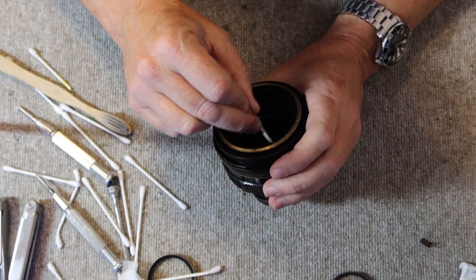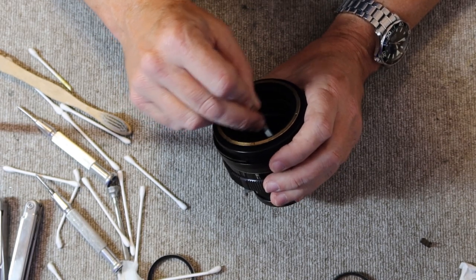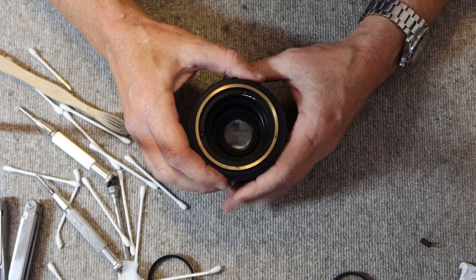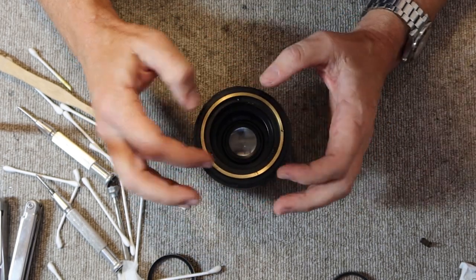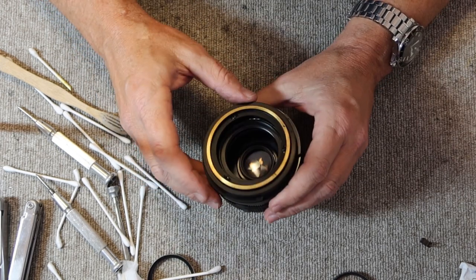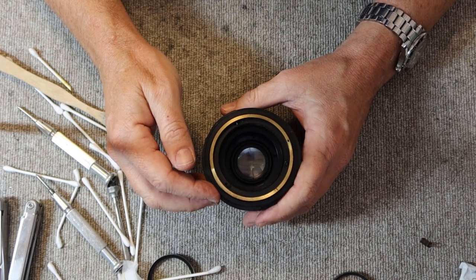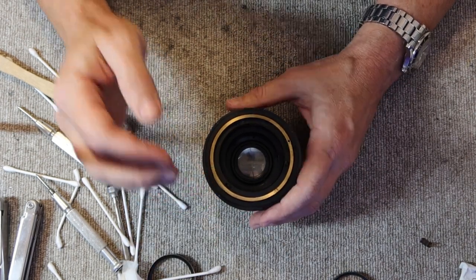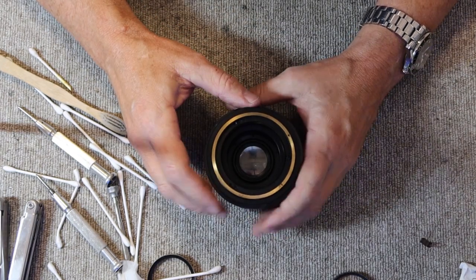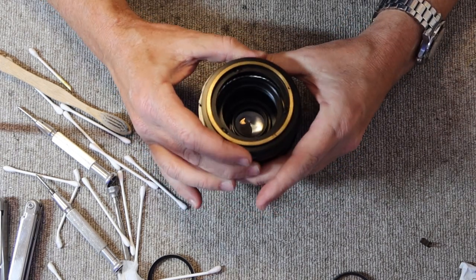Other lenses are kind of prone to sticky helicoids, the 127mm lens especially. You can free it back up, but it's not like this lens here. The 127mm lens has a couple of dust covers which are installed, and those have to be removed. And then you can access the threads to the helicoid. You can lubricate them and sometimes add a little naphtha or lighter fluid. This thins down the oil and allows it to penetrate. And then replace the baffles and screw everything back together. Work it a few times and it gets easier.